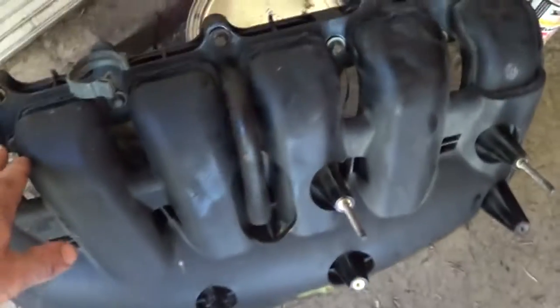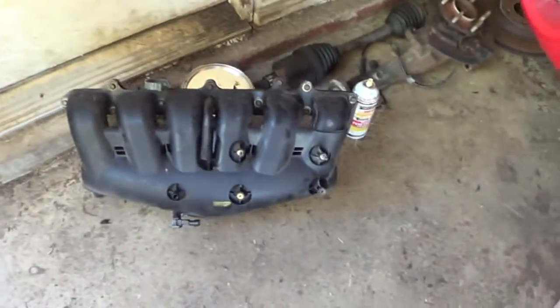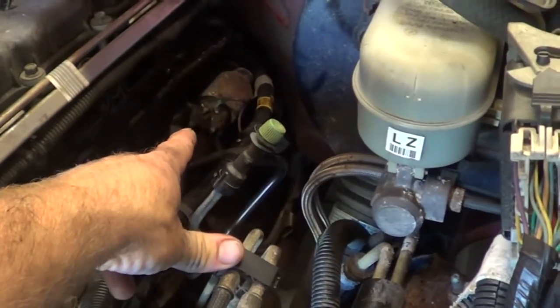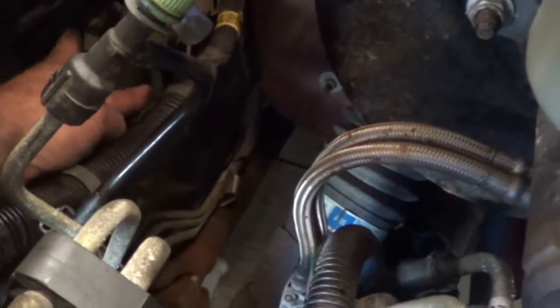Keep it off the ground, and there's also some electrical loom you've got to deal with too. Not that bad to pull, but somewhat of a pain. Now we have more access in here to get to more of the electrical connectors. I'm going to start next by getting ready to take out the starter, which is just removing the electrical connections — there's one here and one there.